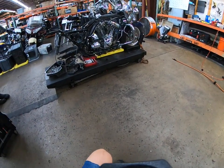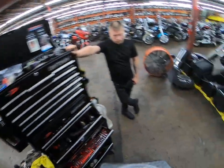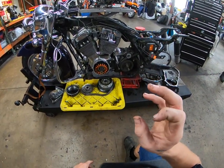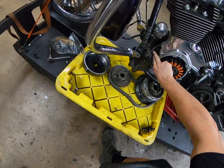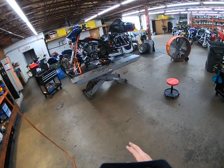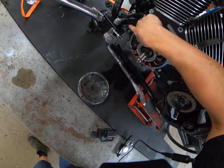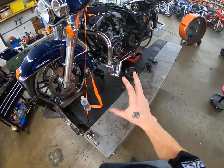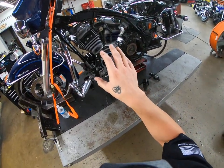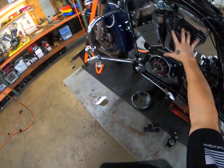There is one big difference on the electrical system which we've encountered as a problem. The electrical system on the Twin Cam 96 is using a three-phase system — three wires coming out, 50 amps. On our Twin Cam 88, this 2005 is putting out 45 amps on a two-phase, two-wire system. That being the first difference. We did a bunch of research online with part numbers and found out that in 2006, this bike actually went to a three-phase system still running on the Twin Cam 88A.